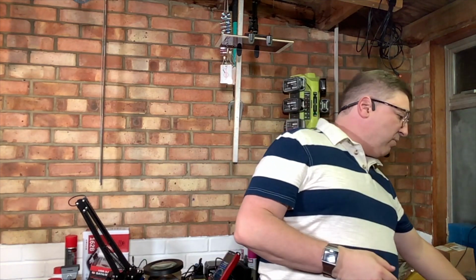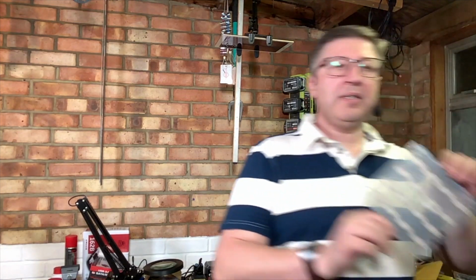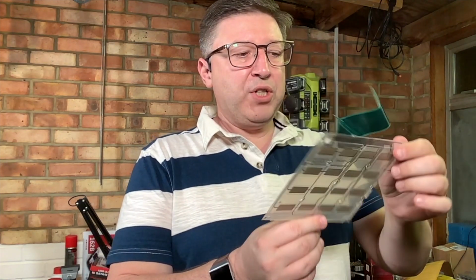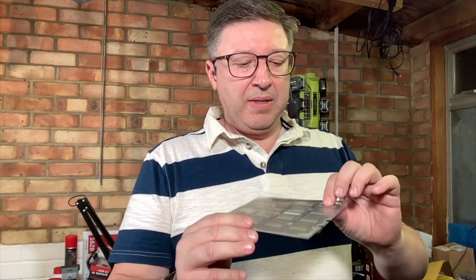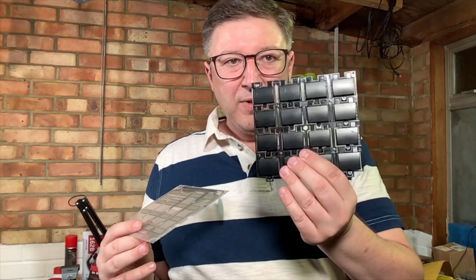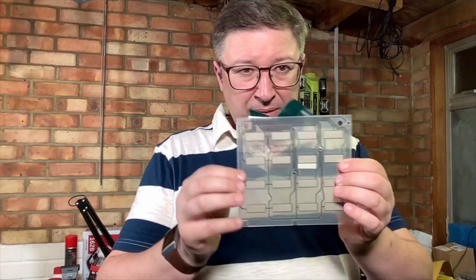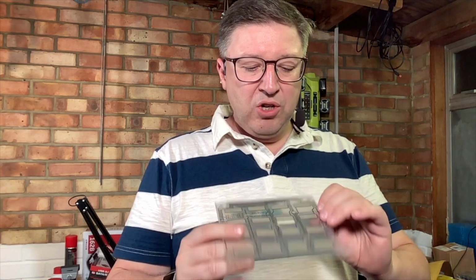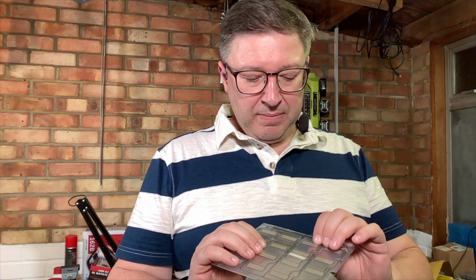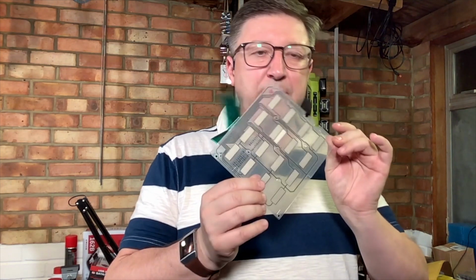And the reason why I'm pretty glad I did take it to pieces is because this is the actual drum machine membrane. So this is the bit where the big buttons that sit on the front of that drum machine strike onto. And this was absolutely filthy. It really was. There was a lot of muck on this thing, which meant that these things wouldn't have made contact correctly. So that's been given a good clean.